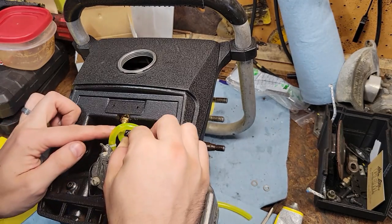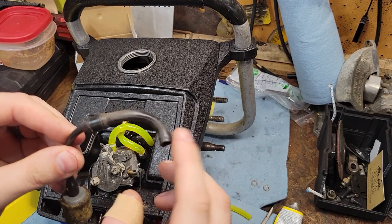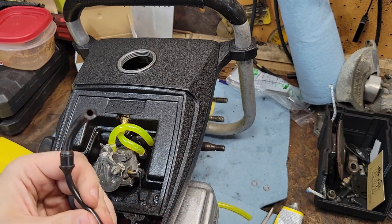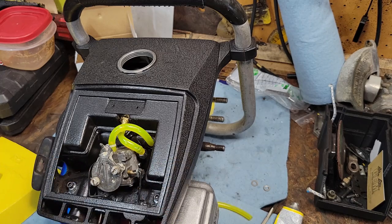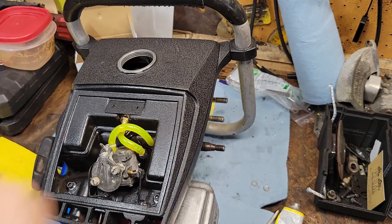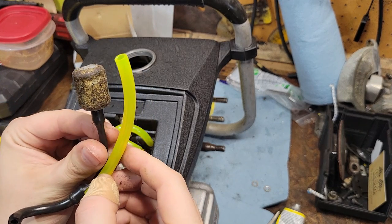You have your fuel system almost hooked up. I have to figure out this fuel line. It's ripped at the end here, so there's no saving it. So what I do, this might fit into the inside of one of these. If not, then I cut that and I put it on the inside fuel line, like generously put it inside of this Tygon, which I've got plenty more of, a whole roll of it up there. So measure out what it wants from the tank and everything, which this looks like God's plenty.